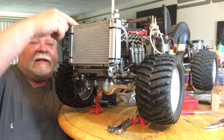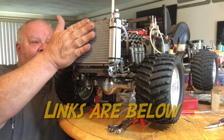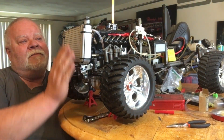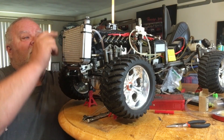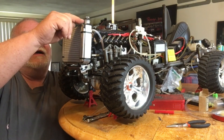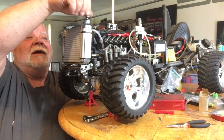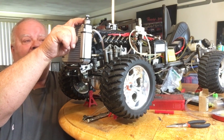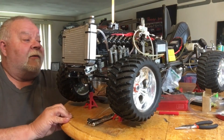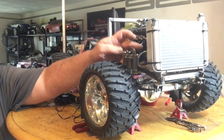You can see I converted it — I cut the side off up here. It had two spouts on the top; it comes with tubes you can use if you want. I kind of wanted a scale-looking radiator like a big Chevrolet diesel radiator, and it does transfer the heat very well. I used metal bond when I cut this off and just a piece of aluminum and metal bonded it on. I cut the lip off, metal bonded a nut in, then put a tiny little rubber O-ring around the bolt — it goes in there and seals it up good and tight. I did have a hose blow off during prior testing, so everything's kind of wet here.